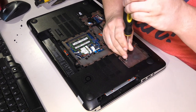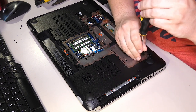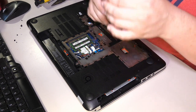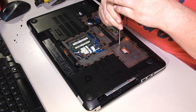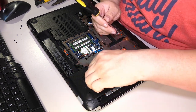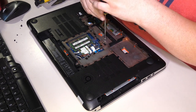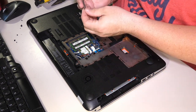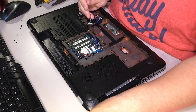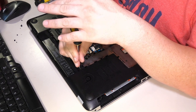While I'm doing that, I might as well go ahead and get these drive tray ones put back. So in summary, you have 8 of these short screws, and they go under the CD drive, DVD drive, whatever, and the 2 hard drives. Pretty easy to remember. 3 teeny tiny screws that take a double zero Phillips go in the battery area, but you'll probably want to put bigger screws in place before you attempt to put the little screws, and I'm putting one of those bigger ones here.